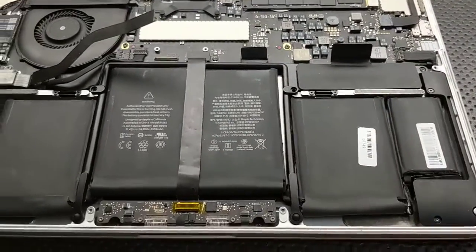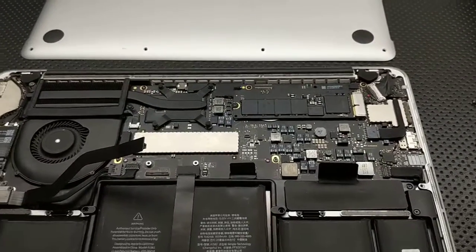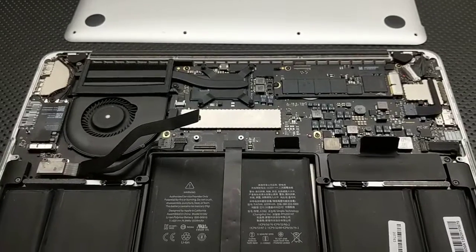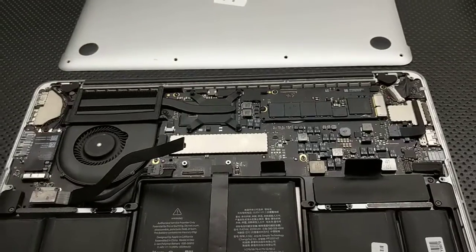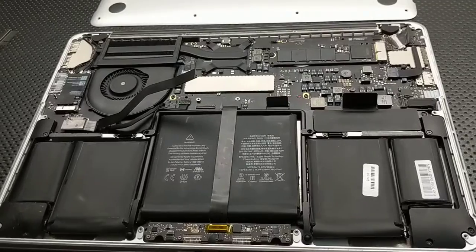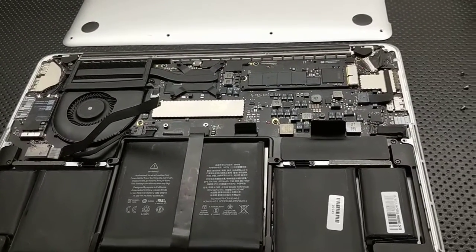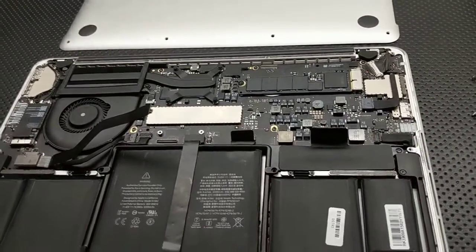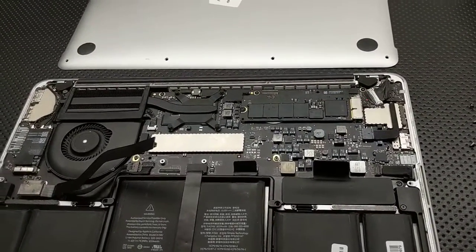Standard process: took the motherboard out and cleaned the corrosion — it really didn't look that bad. I had another fully working unit just like this, same year, same everything. So what I did first was swap the board onto the other machine so I know I have all other functioning components, making it a lot easier to determine if the board has a problem. Everything worked fine over there.